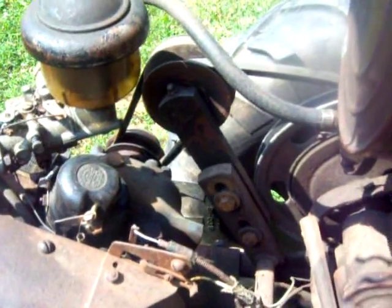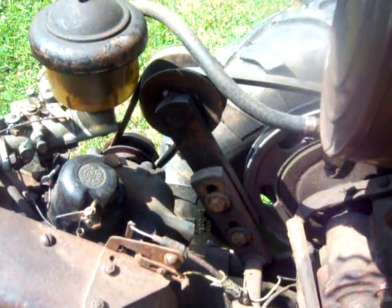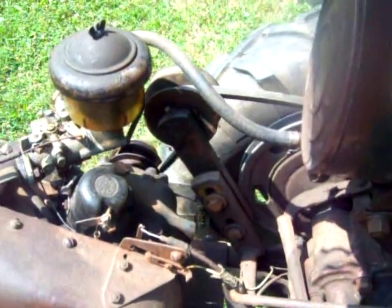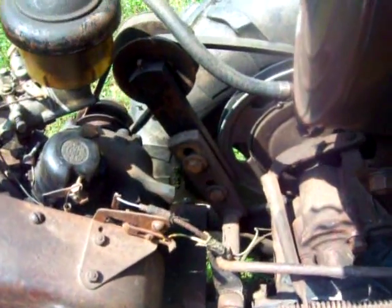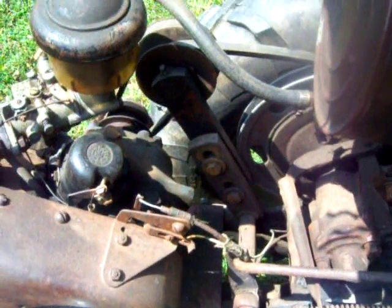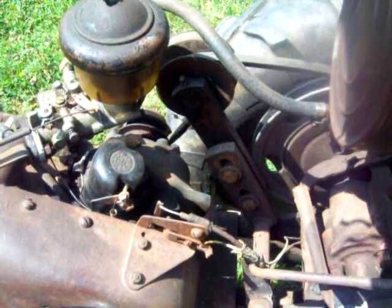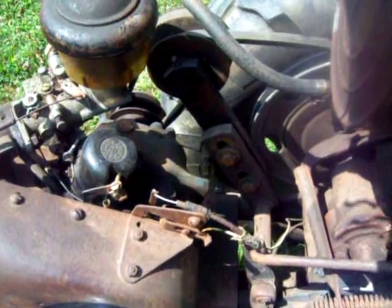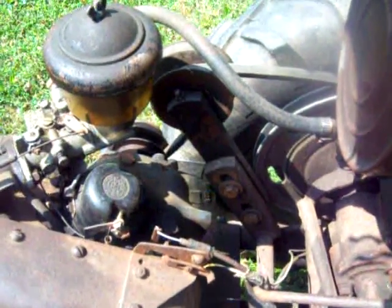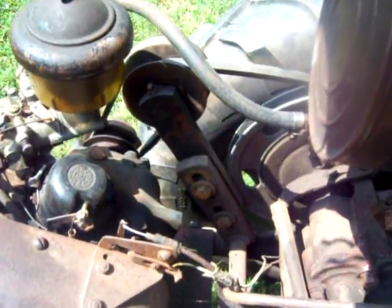Like I said, it's very similar to many belt-driven transmissions on any garden tractor, the less expensive belt-driven transmissions. That's exactly how they work. When you put it into gear, depending on what gear you put it into, that dictates the tension on that belt, and that's exactly what this does. Depending on how you move the lever, it dictates how much tension is on that belt. It's the exact same thing, just in a different format.